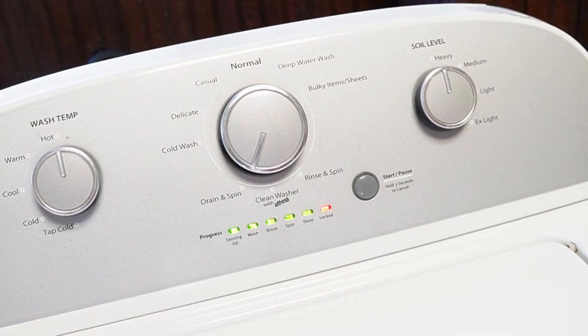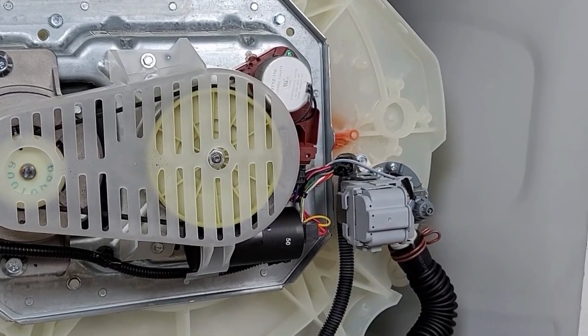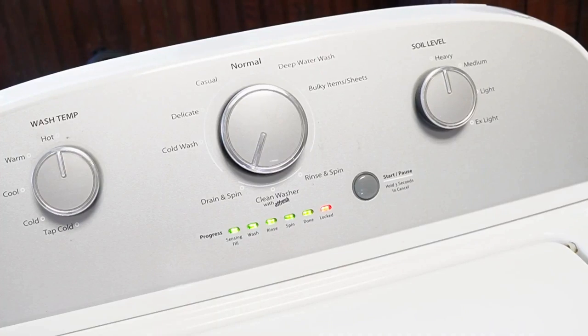All these tests take approximately three minutes to run all the way through. As the recalibration mode runs, every part and process on this washing machine is going to be run and the machine will physically reset all the components to a default state, allowing them to run at an optimal level. This is a must-have when parts aren't working right or the machine just doesn't know what state it's in, like you've replaced the shift actuator or even a control board. You're going to hear all kinds of noises from the machine and that's going to be totally normal during the approximate three minutes. When the calibration mode is at the end, every single light is going to turn off, including the lid lock light, and the machine is now ready and recalibrated for use at an optimal level.